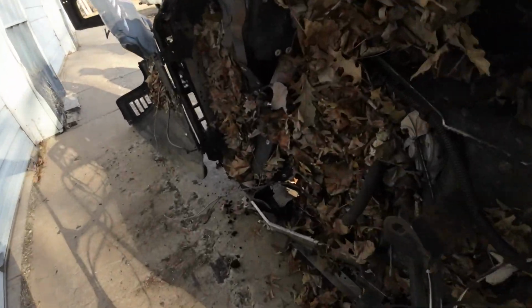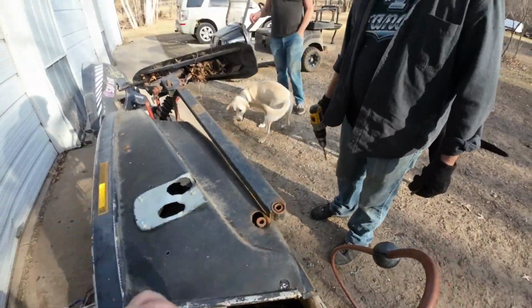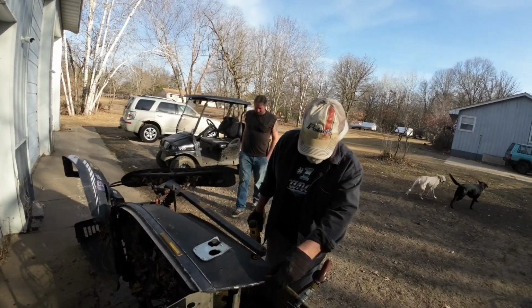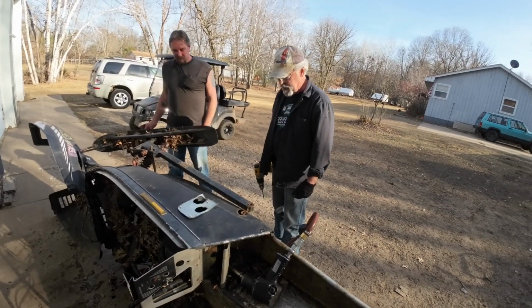It is just destroyed. This sled had a fire at one point. This pan's worthless. But the bolt came right out of the trailing arm mount, so we're pretty happy with that. Brad's here. Hey, Brad. So Tommy's going to drill rivets, and I'm going to get the sawzall, and we'll take out that piece of pan. Should help a lot.